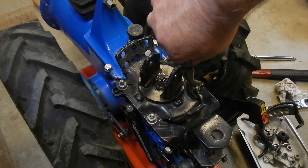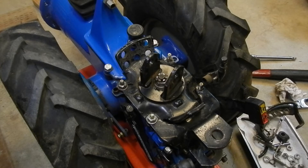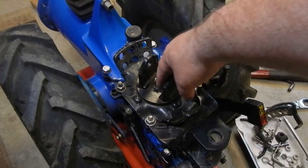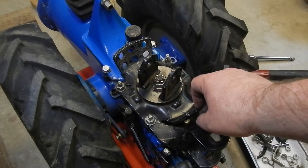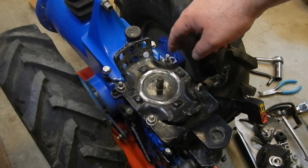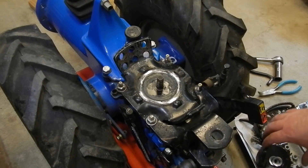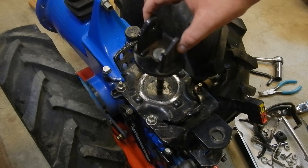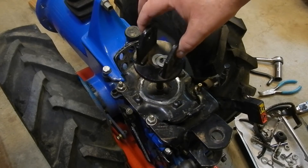There we go. Maybe there's not a washer, but the spring is right there. Now I'll remove the pin and castle nut, take this fork off, and remove these two nuts so I can take this hitch off. The 19 millimeter nut came off easily. Once the pin's out, underneath there's a couple of washers, and then the fork just lifted right off. After I get everything cleaned up for reassembly, I'll have to remember to grease that area in between.